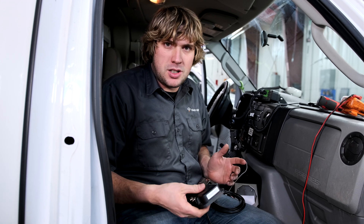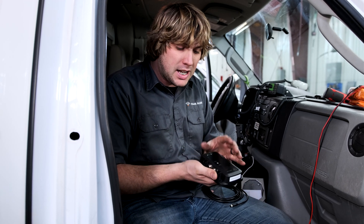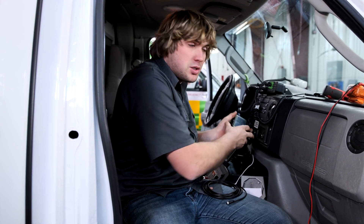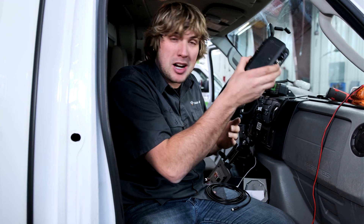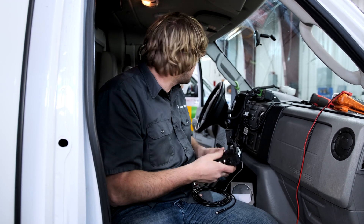Before we start building any harnesses or doing any major electrical work, we want to go ahead and plan the install. When you're thinking about where this device should be mounted, this thing has a GPS and a cellular transponder inside, so it needs to be mounted within clear view of the open air. You wouldn't want to mount it up on the top or down on the console — you really want to mount it somewhere like up on the dashboard. Now when you're mounting something on the dashboard, keep in mind that there are airbags in these vehicles, so don't mount this in an area where an airbag could fling it into an occupant in a collision. When I've looked at this truck, I think we're going to put it right over here next to the A-pillar, slide it down right by the windshield so it's got a clear view of the sky.